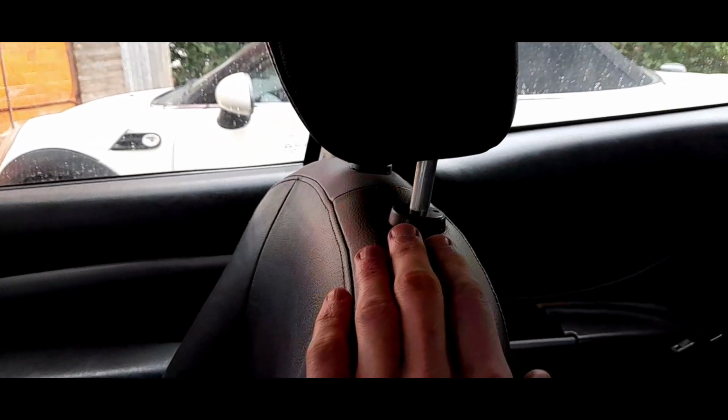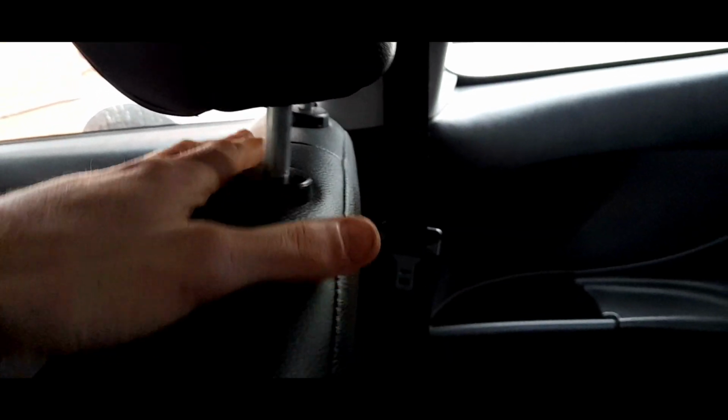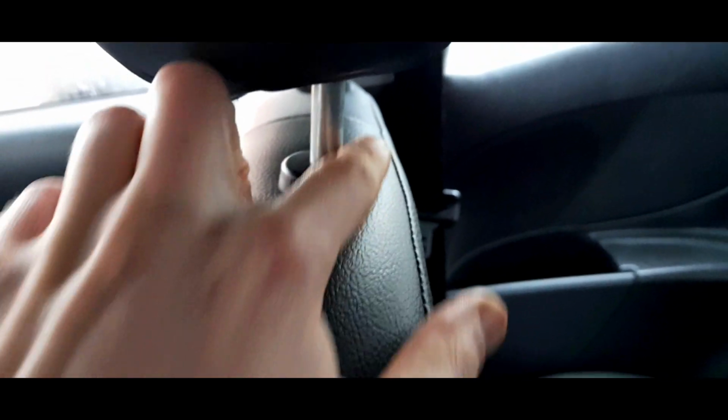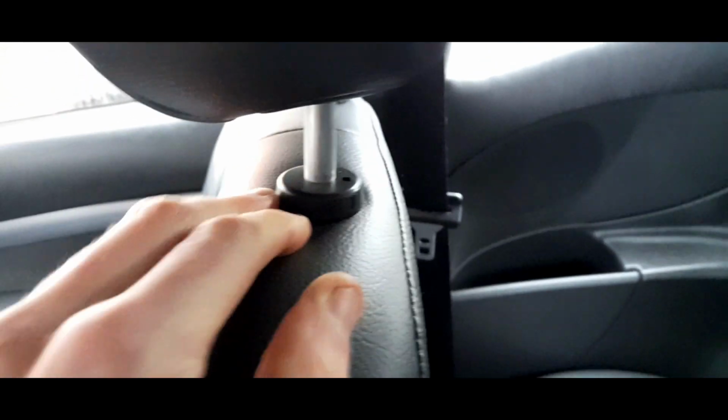Now, headrest. I had this particular issue where this driver's headrest, for quite a few years, and it's always been like that since I bought the car, I think, would slowly sink to the point where it would just sit on the actual ledge of the seat. I was thinking, why is it dropping? I just kept pushing it up and then it clicked in. In fact, one day I just pushed it down with my hand. I could push it down by hand. And it's because these clips can sometimes fail. I had to replace one of these seat headrest clips.